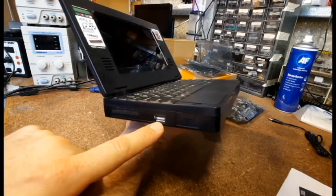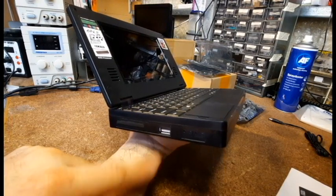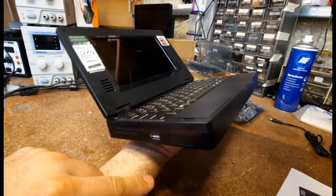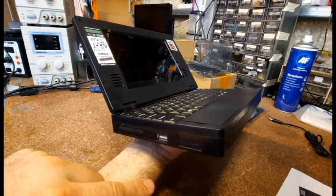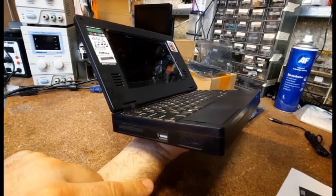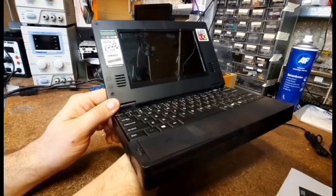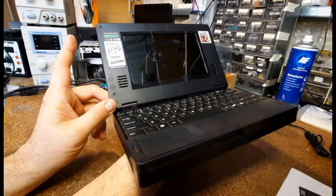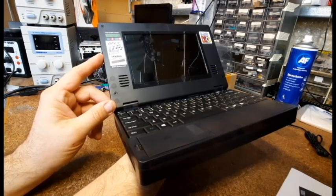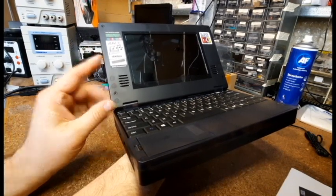So yeah, this is basically just a USB port that you can plug a USB drive in up to whatever the system supports, which is 540 meg. That said, I remember it runs DOS 6.2. I used to use a 4 gig hard drive under DOS 6.2. So it's been a few years. I'm a little bit rusty. There's a BIOS limit of 540. I don't think MS-DOS has a limit of 540 meg, because I used to run a 4 gigabyte hard drive on my Olivetti. But anyway, we'll worry about that later.